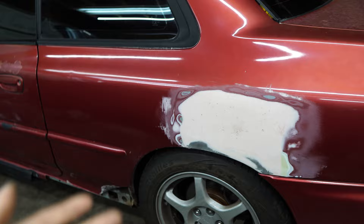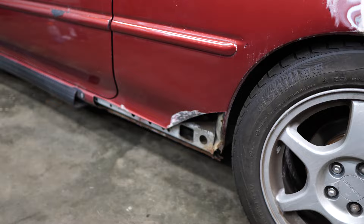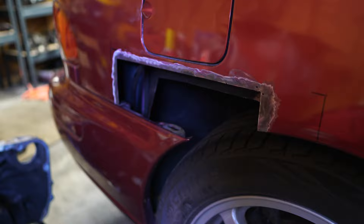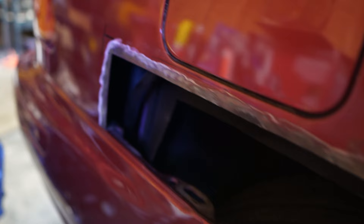I had the Suvi Saver panels. I've been learning how to weld - there's my machine over there. This driver corner is almost done, it just needs to be finished up with the body work and all that good stuff. The driver rocker - 90% of the rust is cut out. I still have a little bit more to do. If we walk over to the passenger side, you'll see that this quarter section has been cut out. All the rust right here is gone. Just need to do a little bit more finishing up on the inside of the wheel well and making sure we protect and coat everything properly so that this doesn't happen again. It's just about ready to be welded in.